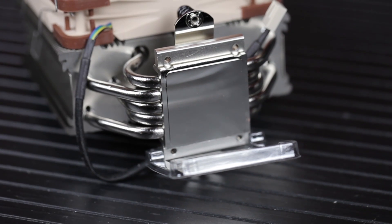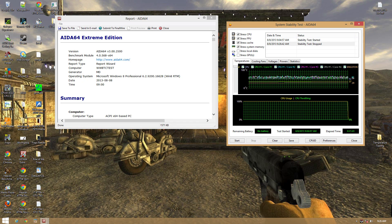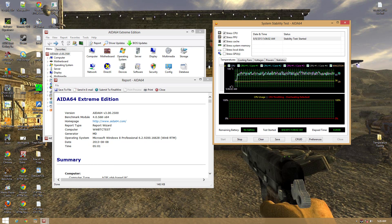Let's take a look at the little guy — the U12S — after 20 minutes. At stock, it's breaking 60°C just a little bit — one of the cores is at 61 but it's going up and down and staying in a very safe, healthy range. At 4.6GHz overclock, the system crashed a couple of times, but on the third run it made it all the way through without crashing. Some of the peaks are getting close to 90 — we got a WHEA hardware uncorrectable crash in Windows 8 twice, but the third time it made it all the way through 20 minutes. So this will work, maybe at 4.5GHz with decent voltage, but I probably wouldn't recommend it for ridiculous overclocking.